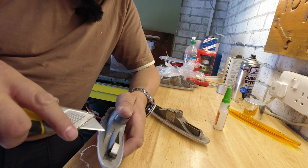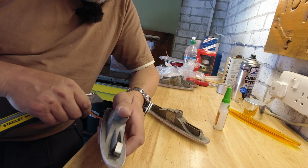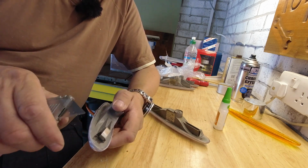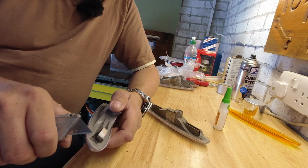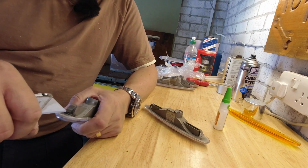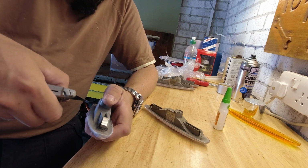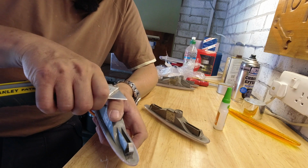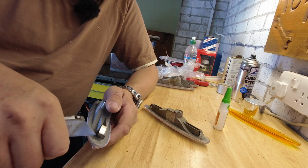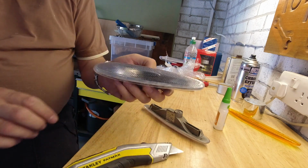So I'm just taking a burr off. If you draw the blade of a knife, probably leaning back towards you at about 15 degrees, so it can't dig in, it's really good for deburring plastic and scraping off excess. Not 15 degrees cut back towards like you're whittling, dragging the blade as if, you know, literally on my skin, I can do that. If I went the other way, I'd cut my hand off. That's the way I'm doing it on a plastic. There we go.